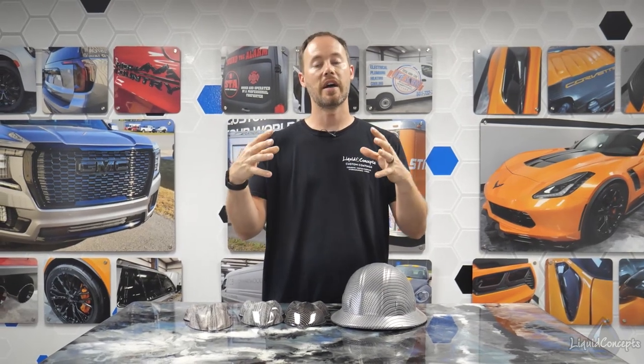The other thing is UV resistance. If it sits outside — say you did a set of rims or mirror caps on a car that sits outside all the time — you're going to want that UV resistance. Hydrographics does have some UV resistance built into the inks themselves, but not very much. The clear coat really helps because it ensures you get much better UV resistance, so that with a colorful print, those colors don't fade out within six months to a year.